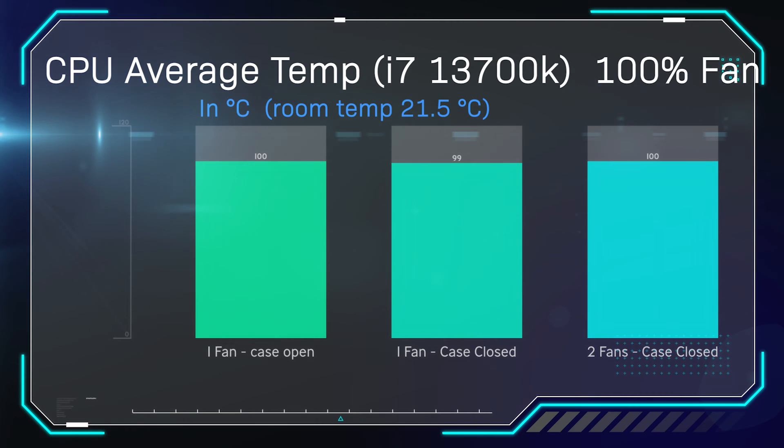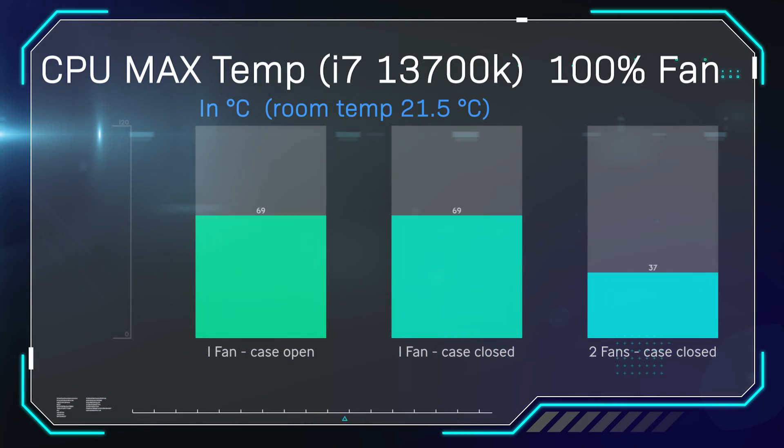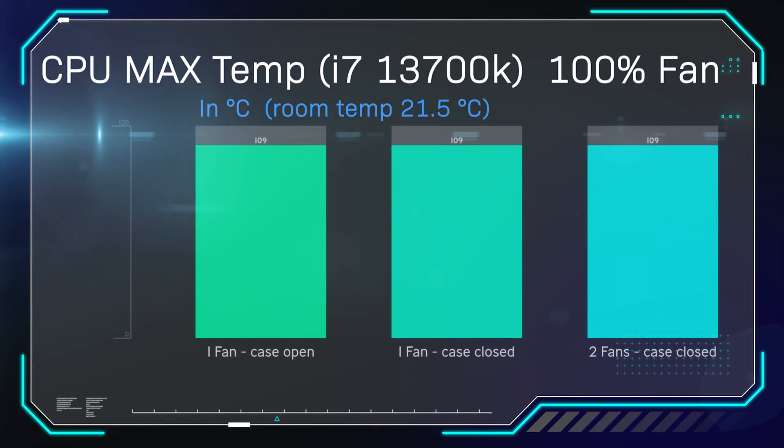Down to the test results. First we tested with an i7-13700K processor and got pretty bad results, to be honest. We were thermal throttling in pretty much every configuration — with the case open and just the CPU fan running, with the case closed with case fans also running, and even when we added an extra fan we still got thermal throttling. Temperatures were in excess of 100 degrees Celsius. The machine didn't crash, but it did slow itself down, meaning it wouldn't perform as well. This is one of the reasons I wish cooler manufacturers would state the TDP or give a rough idea of what CPUs the cooler can handle.